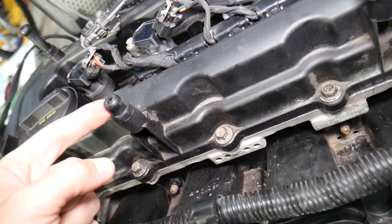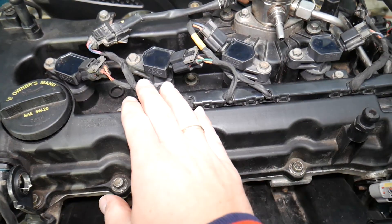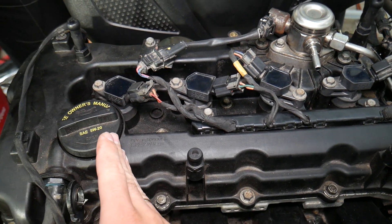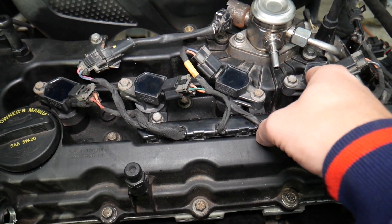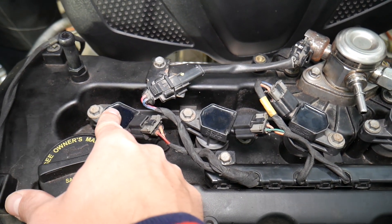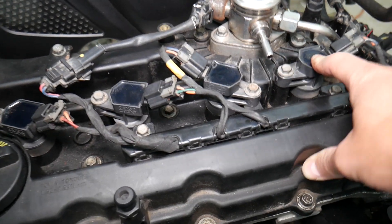You can see the four posts right here. If you have any of these codes — P0351, P0352, P0353, P0354 — it means you most likely have a problem with one of the ignition coils. There are four ignition coils, one per cylinder. Cylinder number one starts from the very first on the left. Code P0351 means cylinder one, P0352 is cylinder two, P0353 is cylinder three, and P0354 is cylinder four.